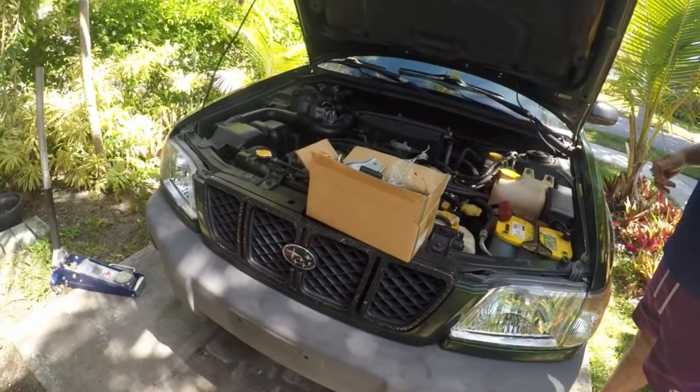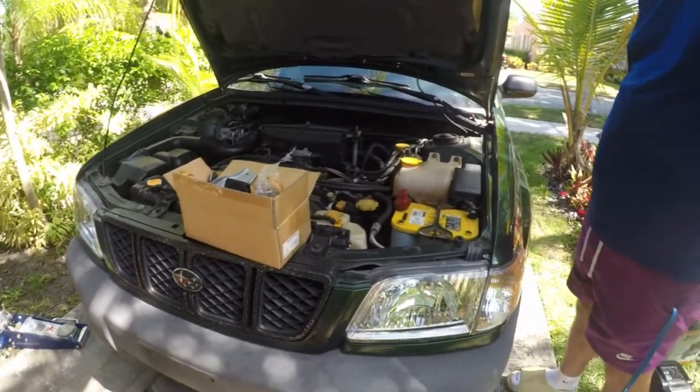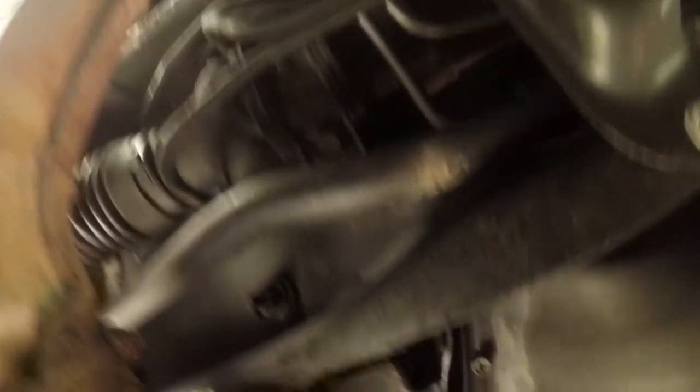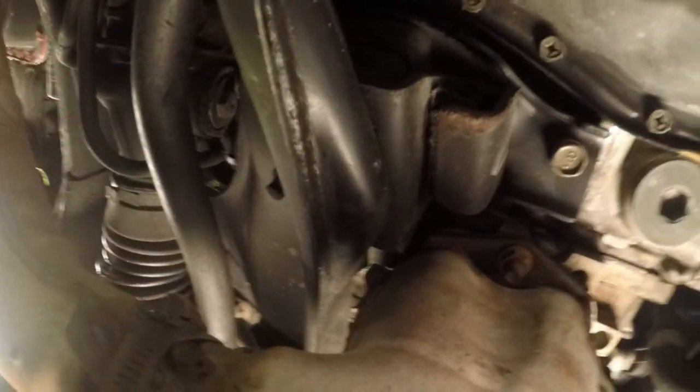What we gotta do is get underneath the car, jack up the motor a bit, then unbolt and swap it out. It's a little hard to film underneath here, but this is motor mount one, and here's the other motor mount. It looks like we have a 14mm bolt here, and then the other one mounting to the subframe — I think that one's also a 14mm. We're gonna take those out. I would do a time lapse but it's pretty tight under here, so I wouldn't really be able to mount the GoPro anywhere reasonable.